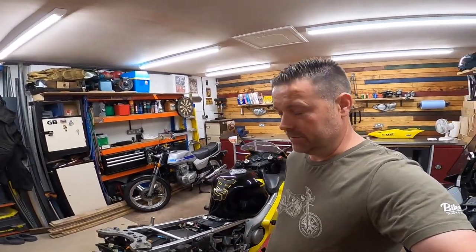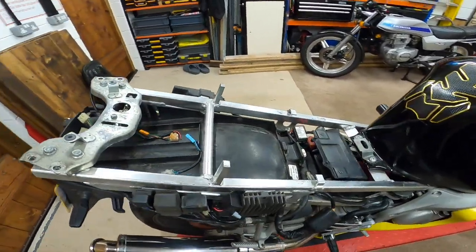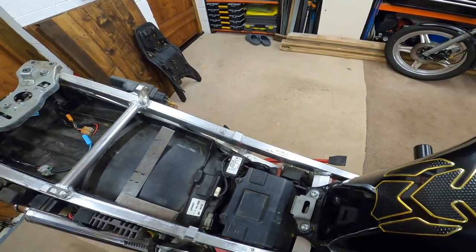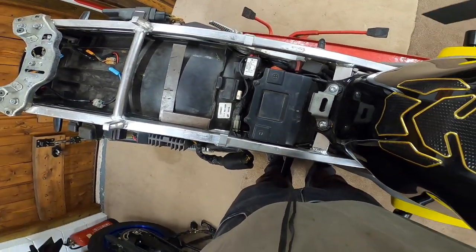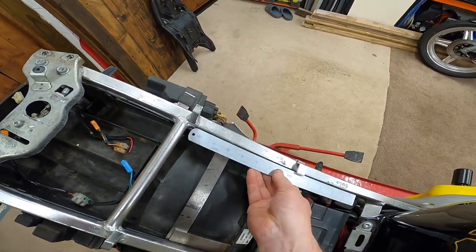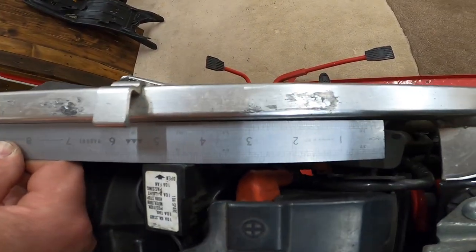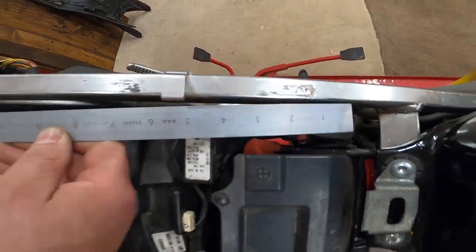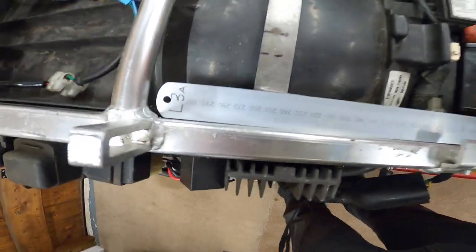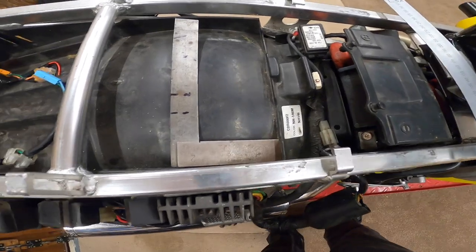Update on the CBR 600 - good news. We've got the rear cowl and seat off. What I've just discovered with my straight edge here - the cameras do tend to fish-eye a little bit - but if I hold this straight edge on here, we're touching there and then it kicks off at this end. We have a similar result at the other side - it's touching there but then we get to this end and the gap is much bigger.